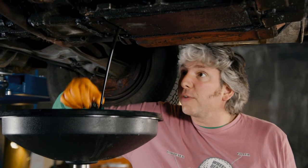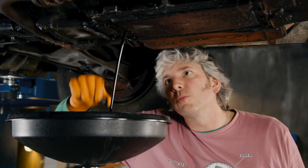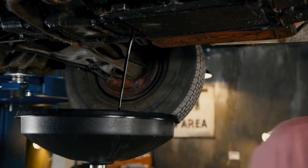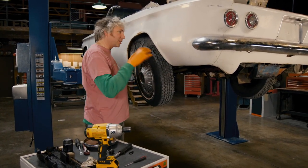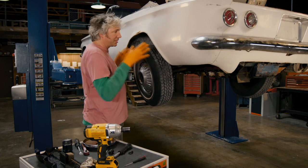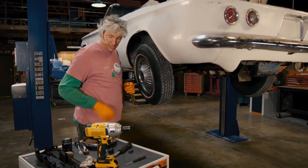This is definitely one way of ensuring that the oil leak stops — I'll probably have to put some more back in there. I can probably change the pushrod tube seals on the engine itself, but there's so many other things I'd like to have a look at. I think the better thing to do is take the engine and gearbox out as a lump and pop it onto the bench and have a better look that way.